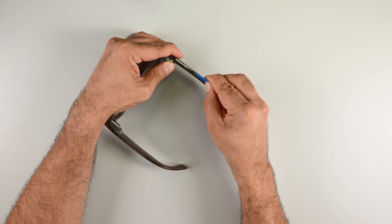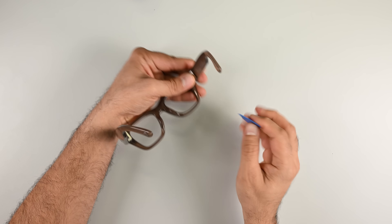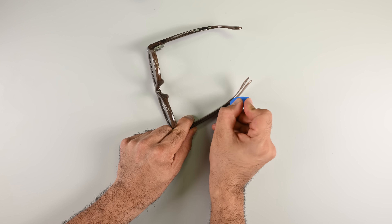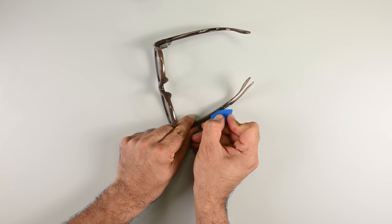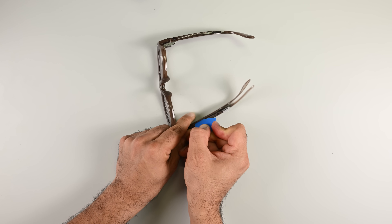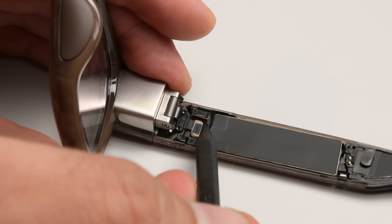The inner cover of the arms are glued in, making removal and replacement a bit of a hassle. And because these glasses are IPX4 rated, anything more than light rain risks damage, so the glue feels like overkill. It's a shame that Meta didn't decide to use some means of clipping the two halves together to make it easier to access the one consumable component inside — the battery.